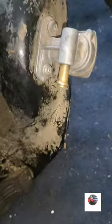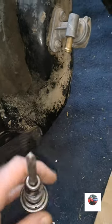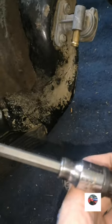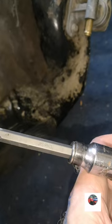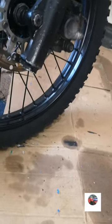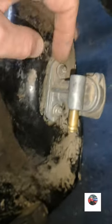That's it on now. Always use a good fat bit like that. One of them posy bits, right, JIS bits they're called. I keep calling them posy bits and people keep correcting us. But if you use them, they don't round the posi screws off on all the engine and everything. That's how you normally get DTRs with every screw rounded. Plus, if you use a normal screwdriver on this, they get rounded and they're hard to get out.